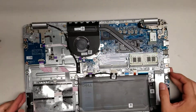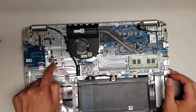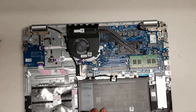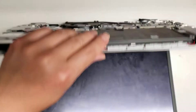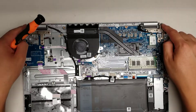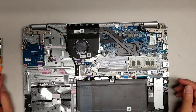You also have the fingerprint sensor and the power button — it's all built into one circuit board. When you take off the cover, open and close the screen carefully because it has one less screw holding it down, so it's not as strong.